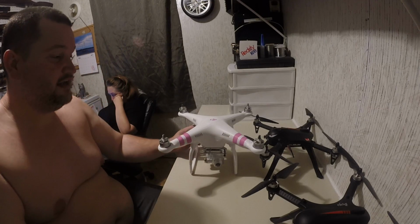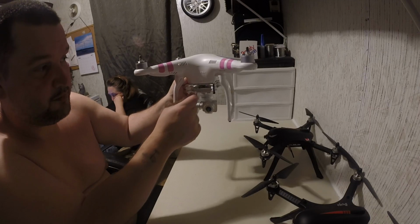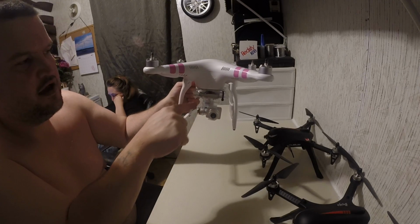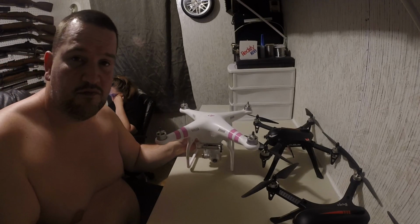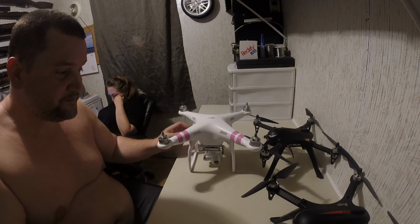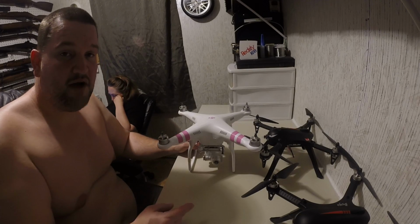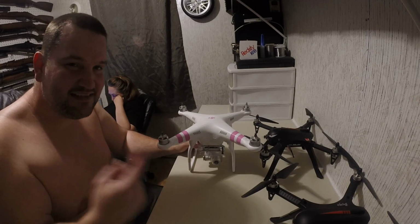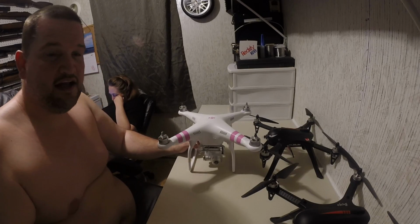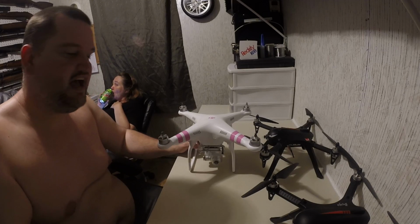So thank you for watching, and if you have that problem, please check your gimbal wires, like the plug itself, and also unplug it and try to give each wire a little tug with some tweezers, because that's what I did. And boom, it was there. I didn't think I would have something that simple, because I'm always the guy that has to replace everything. Just because it fell, the IMU would say, nah, I don't want to work no more.